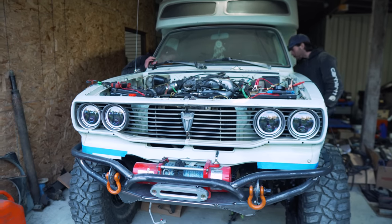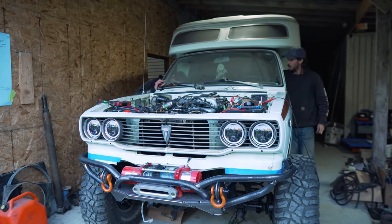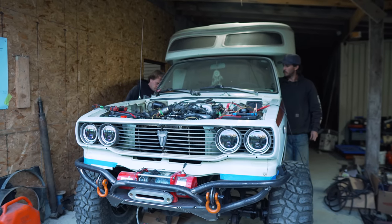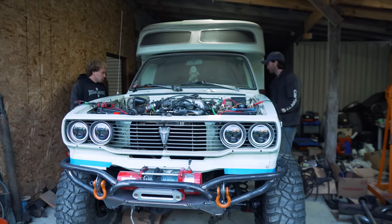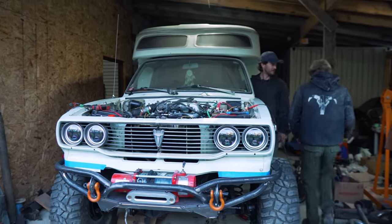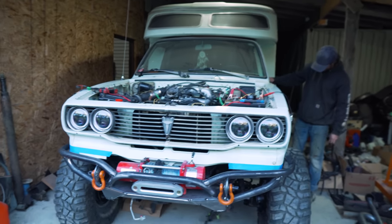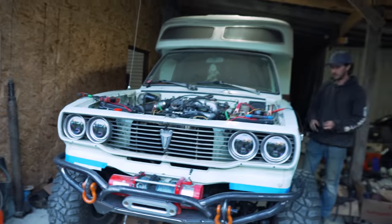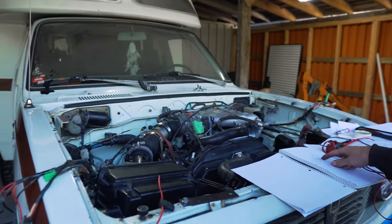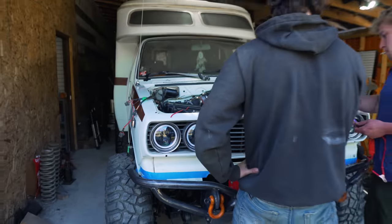Despite what you guys may think, this is our first ever engine swap. And because of that, we reached out for some help. I was able to get a lot of help from Mr. Clinton Penner, as you guys probably know as Dirt Garage. He spent some time with me on the phone labeling all of the 3.4 wires that I would need to run in the Chinook. We're basically making a standalone harness so we can keep all the Chinook wiring factory and all of the 3.4 wires that we need factory. I then got my buddy Jeff down to the Chinook to help me put it all together and we just ran some dummy wires twisted together to test everything to make sure that it was going to work.